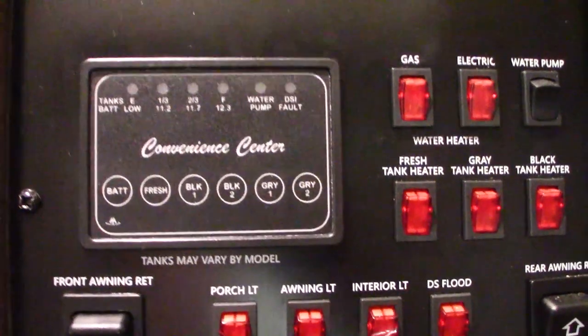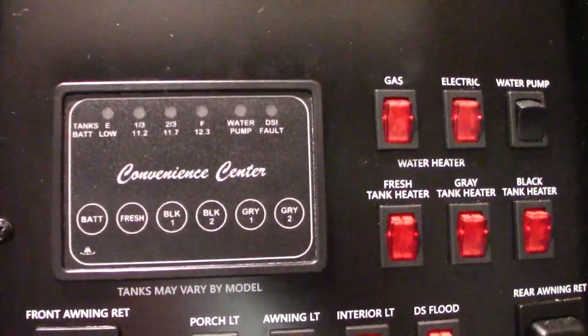See what I mean? Those are empty, and they should not read as if they are half full. I'm going to fix it. Both the gray tanks and the black tanks were emptied, and then I filled them up about 1/4 full with just plain water. Now, I'm going to clean the black tank with bleach and each of the gray tanks with two different methods. I'm going to show those to you right now.